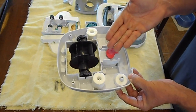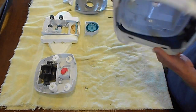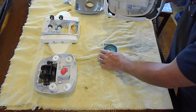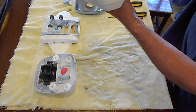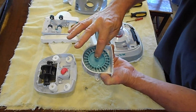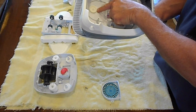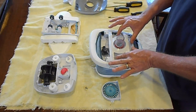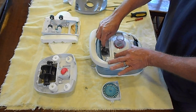If you've gotten to this point and you blew into it and it's good with nothing stuck, but the problem persists, there must be something else wrong. As covered in the teardown video, you also tear down the turbine assembly and the gear inside it. Pull it apart and look to see if the teeth are torn up in any way — it's pretty rare, but it can happen.